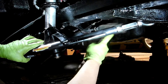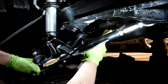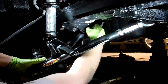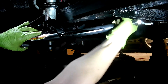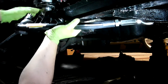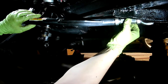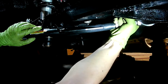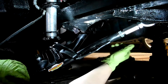I recommend putting in the strut rod piece first and then adjusting the length so your lower control arm lines up correctly, because it'll want to bind as you go through the suspension travel. You've got to make sure that length is just right so that when you're at stock height — about when the lower control arm is almost level — there's minimal bind and you can actually spin the adjuster left and right, staying within that range of free motion through the full travel up and down.